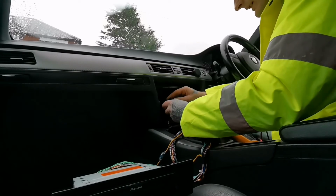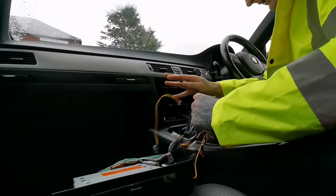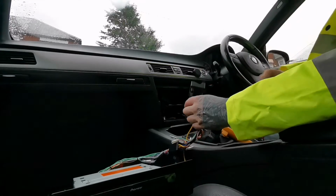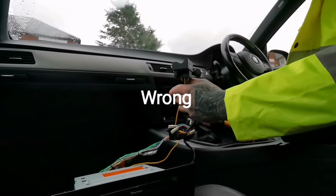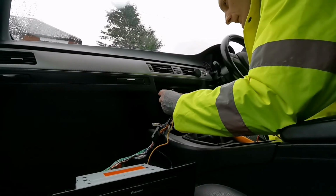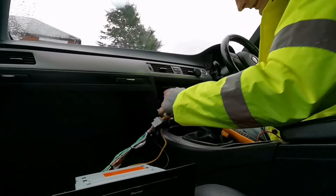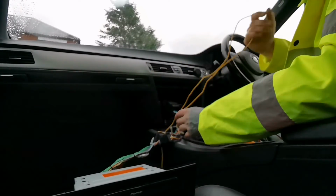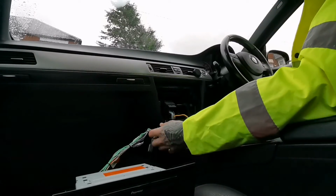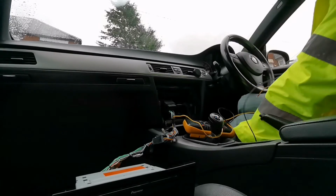So right, let's get rid of this big part of the wiring harness. You don't really need that. So far, this is for the speakers. This, I believe, is for when you've got a Bose sound system, which this hasn't got. This is just a standard 4-channel output radio. Right, let's see where we're gonna get the power. Going directly into the wiring harness, clip it down. This wire with the fuse not at all. So let's check what we have. Let's check what's where. Because this should work.